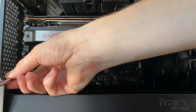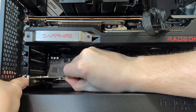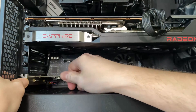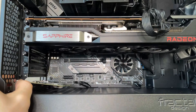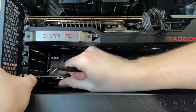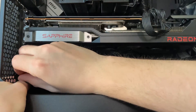Take out the screw and the protective piece and try to insert the Wi-Fi 7 adapter into the slot. I had some trouble getting it fully inserted because of my cable management — a fan cable was in the way. To solve this I simply moved the cable to the side a bit to push the adapter all the way in. Then use the same screw to tightly attach it to the adapter.